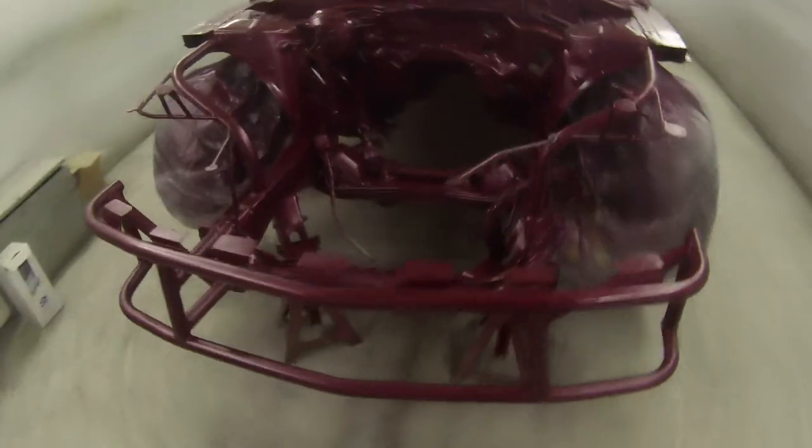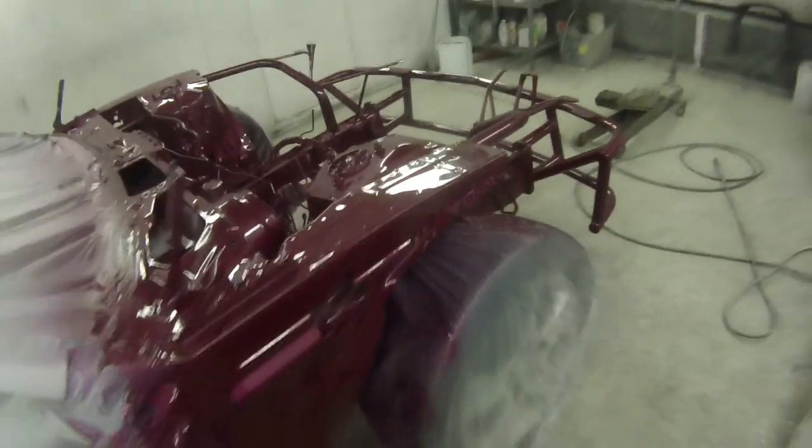I did about three coats of base coat which you can see here. It's pretty tricky to get into all these different angles, and the red especially doesn't cover that well — that solvent based base coat you see me using there. I matched every single colour on this car, from the 2K white to the red, the green and the blues you'll see later on, even the ground coats and every single stage. I'll elaborate on that a little bit more as we continue on with the job.